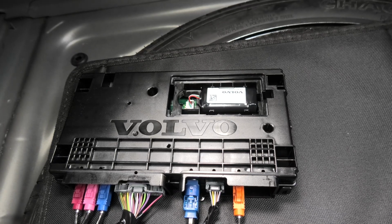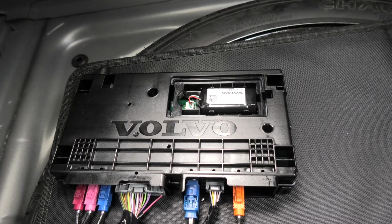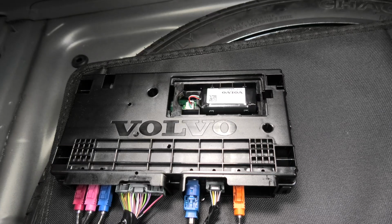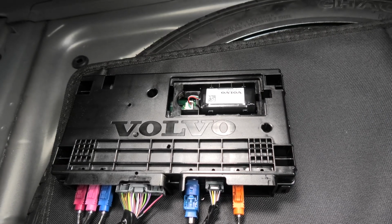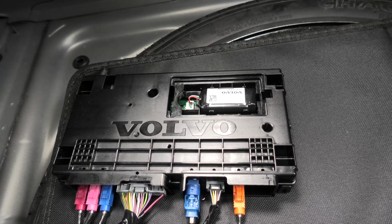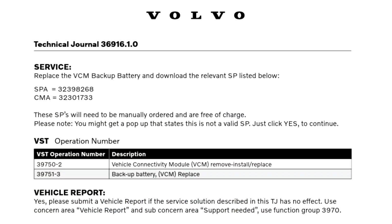Again, to be more specific, if you have replaced the failed battery, say after 6 years, the message will disappear, but it will still reappear in 2 years anyway, since the system does not know that the battery has been replaced. Again, the reset at the dealership will remove the message in case it is still present after the replacement, and it will also reset the age of the new VCM battery. I will also leave you a link in the description to the Volvo technical journal, which specifies the required software part number.